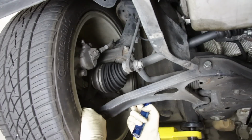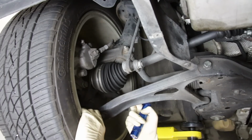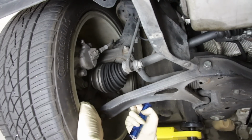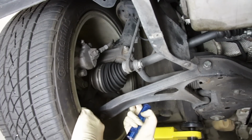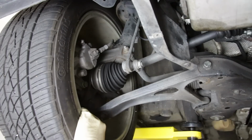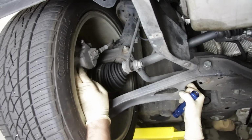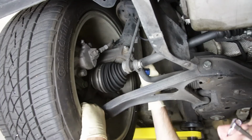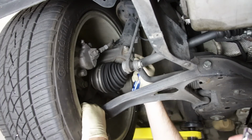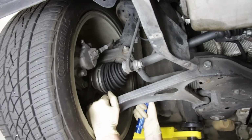And if you hear that, the coolant after run pump is running, which is normal, and they will get loud as they go bad. So on this vehicle, the coolant after run pump is actually on the passenger side front near the radiator, and so that thing is running, and they get louder as they get worse. So, and we can take a look at our caliper. It looks like everything's okay there. Just make sure you got no leaks. I wouldn't expect to generally find any. And then you can, pinch bolt here, no big deal. Everything looks good. And then we're going to go around to the back side where the tie rod is.